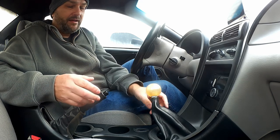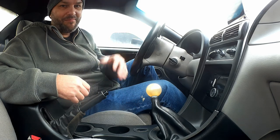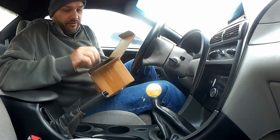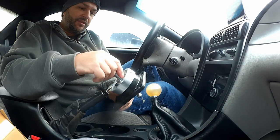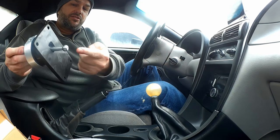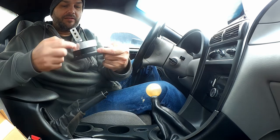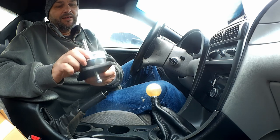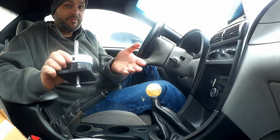I thought about how I could try to fix that — possibly get a longer shift boot if I can. This one's made for this car; it's not some third-party thing. I actually got this one from LMR, so it's not even some random eBay thing. Instead of trying to replace the boot with a different kind of boot, I thought I would try something I've never done before: a short shift kit. This whole assembly changes the lever underneath the shift boot that interacts with the transmission to tell it what gear to go into. It's got a little ball that fits inside a cup and pushes the linkages back and forth. In addition, it has a different fulcrum location — the pivot point is higher up, so there's a shorter part at the top and a longer part at the bottom. That's what gives you the short shift. It should also be a little bit tighter than the assembly that's in there now, either because it's not worn out from 28 years of use, or because it's built to actually be a bit tighter.